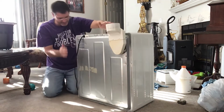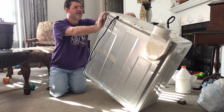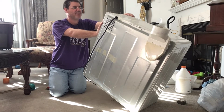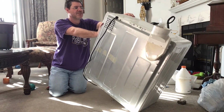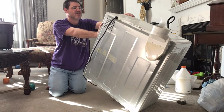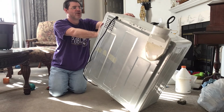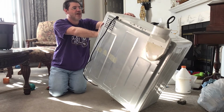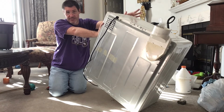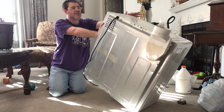I'm seeing if I can find the ratings. Okay. Tumble dryer model HLP 140E. 120 volts, 60 hertz. Motor is 80 watts. Weighs 53 pounds. And this is 27 by 24 by 17 approximately. Rated input current is 9.5 amps. Drum size is 2.6 cubic feet. And the power for the heating element inside, the electric, to heat this up, is 1,140 watts.